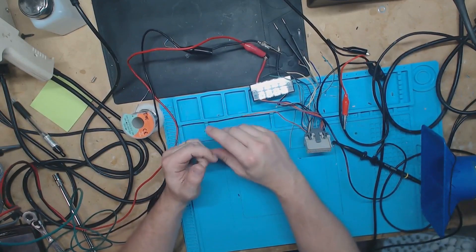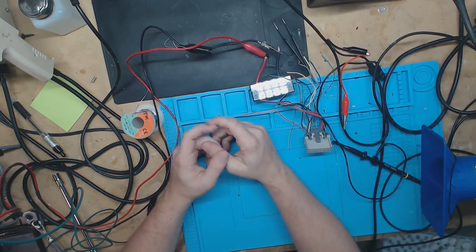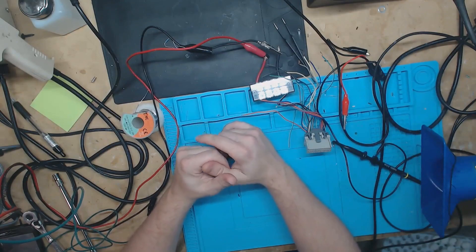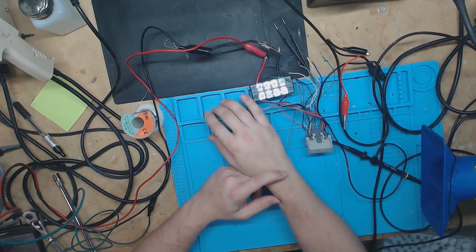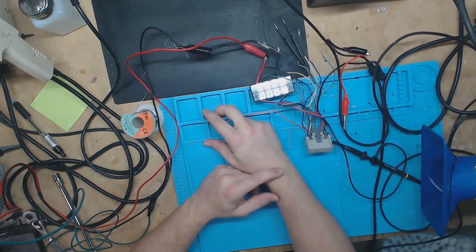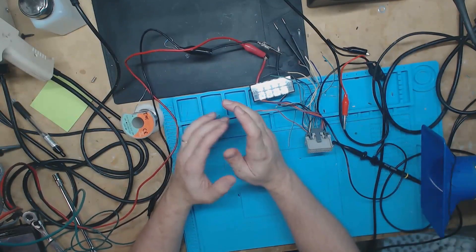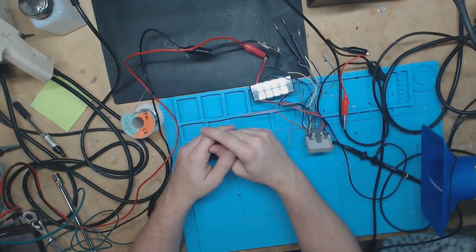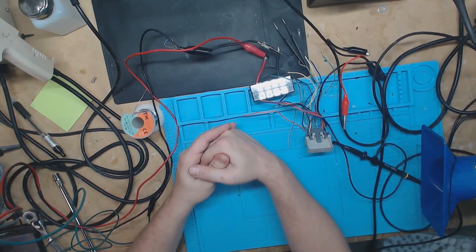The great thing about this box is even though I'm making it with the ECU out of a 2004-2005 Silverado, it'll work with the Class 2 signal coming out — it'll work with a Trailblazer, the older 99-02s, pretty much anything that uses Class 2 in this time frame. One thing it will not do is the voltage gauge through Class 2 — you need a BCM to do that. I didn't grab the BCM at the junkyard and honestly for just one gauge I just didn't care.